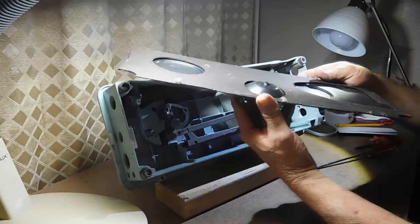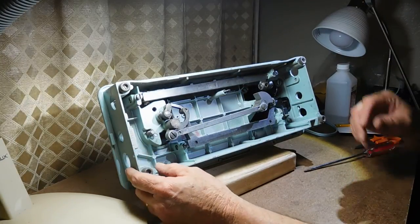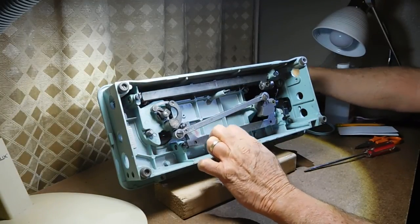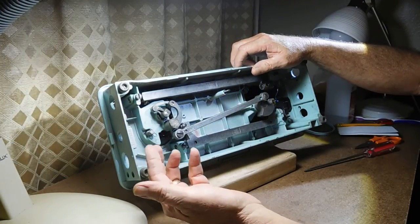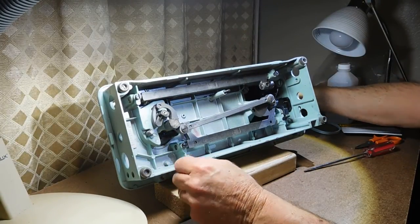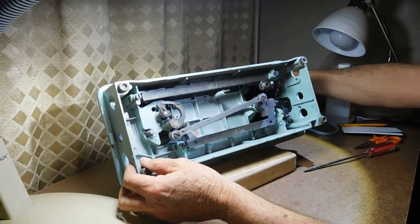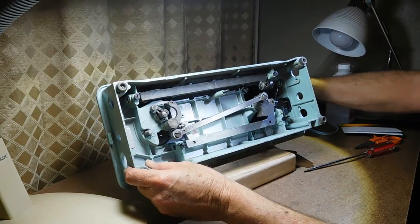The machine itself kind of smells like a locker room, so it's going to need to be cleaned up. Look at this — all metal. Here's the bottom of that oscillating hook mechanism. The body is aluminum — that's why it's lighter. I see some greasy fingerprints in here, so somebody got in here at least once to oil stuff. But I don't see tons of oil and I don't see varnishing. There's typical dust, thread dust, and fuzz, which isn't bad.